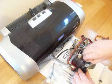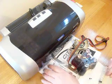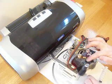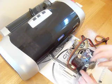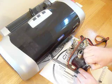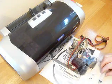It is normal to have some ink in the bottom of these chambers, but what we do advise before you install the continuous ink system is that you draw some of the ink out of here and transfer it to the main pot here. So we're going to remove both plugs, the large plug and the small plug for that colour.